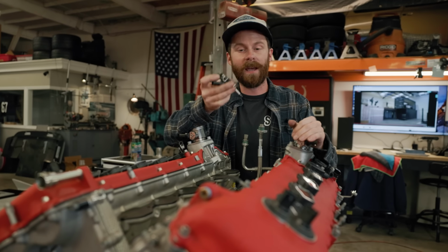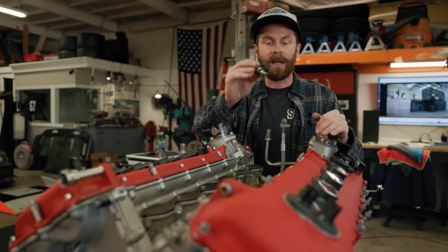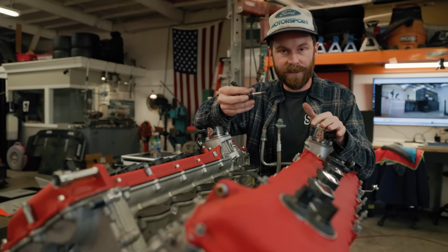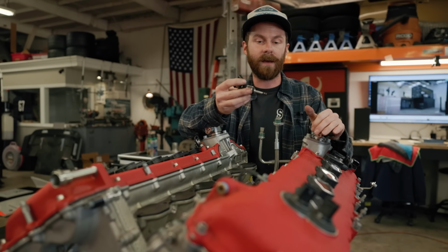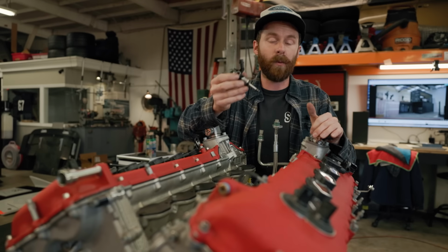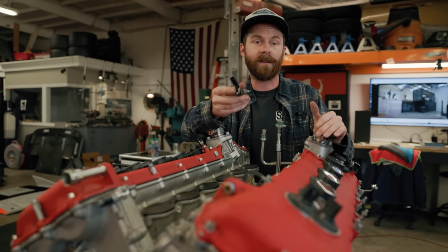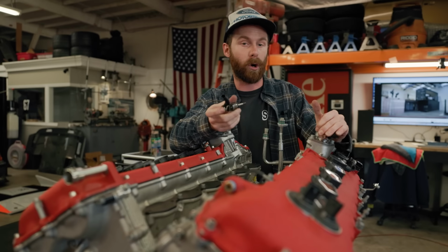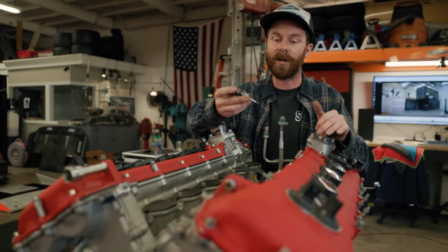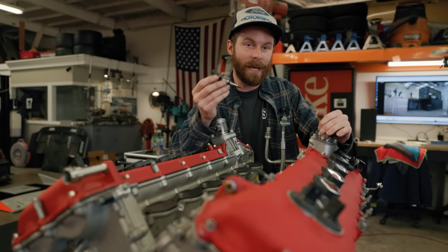There are only a handful of systems out there that will run direct injection. Motec will do it, Life Racing will do it, and there are some other systems that are a bit more affordable. I think that Fuel Tech and Link both have a system that will run direct injection. And some of you pointed out that the Haltech we're running will not do that. And while you are correct, it doesn't mean that we couldn't probably find a workaround using a Life Racing direct injector driver. But again, I don't see any reason to keep this stuff.